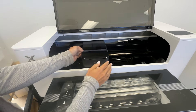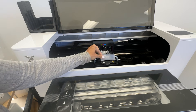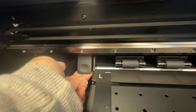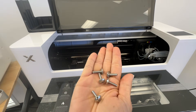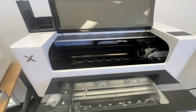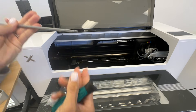Move the printhead towards the middle. We are now going to prepare to load the material. Take the cover off and then push the printhead all the way to the right. You need to make sure that you clear the roller bars, because we need to flip the switch that is going to pull the roller bar up. We can't move those roller bars or the pinch rollers until that switch is in the up position, which can't happen until the printhead is all the way to the right. Now grab the bag of small screws — there are four or five screws in there — and a screwdriver that has two different sides.